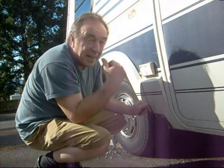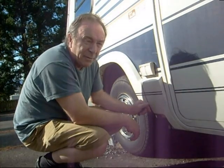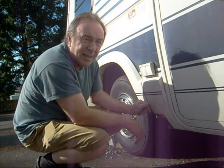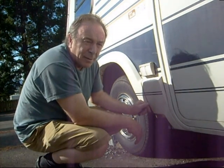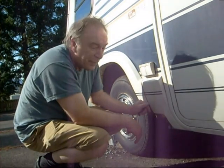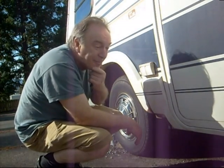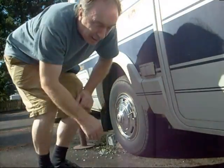There's a tandem brake cylinder in the middle of the vehicle, so I'm going to bypass that. It's just a slight adjustment to the braking system, and I won't be going fast enough to be jamming the brakes on. I went to the auto parts store and bought a piece of brake line with two ends. The brake line from the master cylinder is now directly coupled to the brake line going to the rear left wheel using a brass coupling — works great.